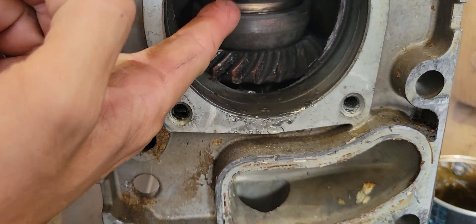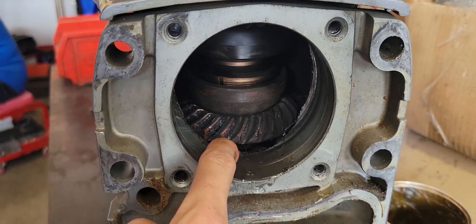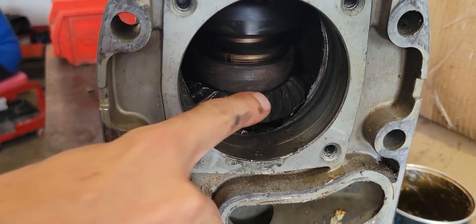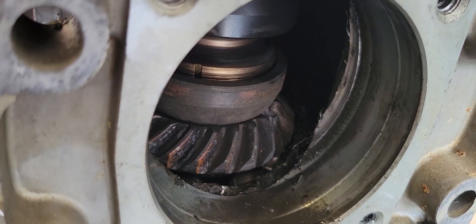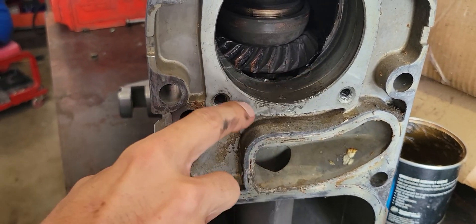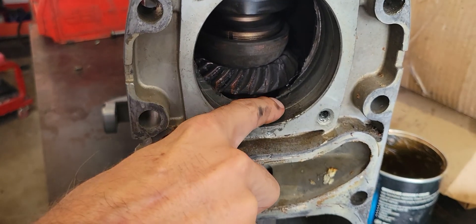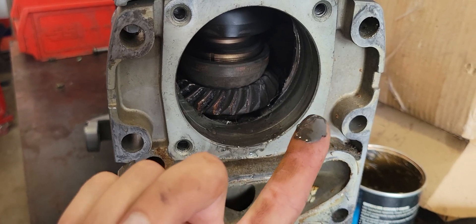You can see your clutch where you're shifting — forward and reverse — but those gears have been chewed up. The housing inside has been chewed up all around, so unfortunately the housing is also ruined. You can also see the condition of the oil that was in there — water moisture discoloration, burnt and just ruined oil.